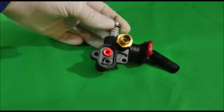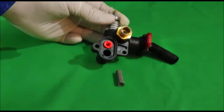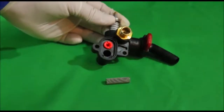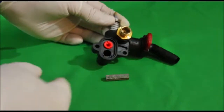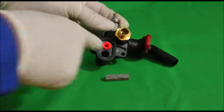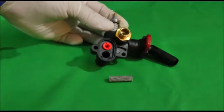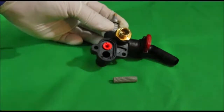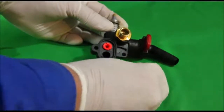In here is the injector screen. On rough water — say iron water, manganese water — that can get dirty. Any kind of dirty water, that screen is there to catch small particles from getting stuck in the small orifice inside the nozzle of your Venturi system. If that's dirty, you can clean it if you don't have a spare, but if you clean a dirty part, you're going to be back to clean it again sooner. Replace that screen — keep these on hand as preventive maintenance parts.